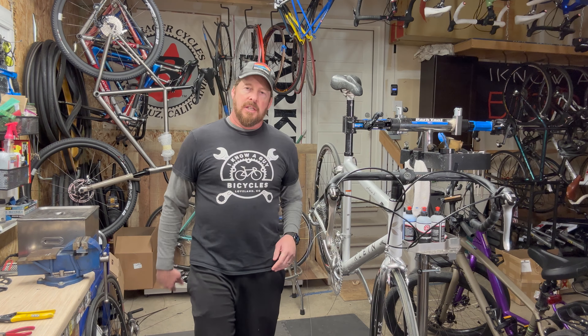On the rear derailleur it's usually about two to three inches. On the front derailleur I like to leave a nice extension, but then we'll be folding it back over onto itself and zip-tying it. Let's do a little close-up — on the rear I did about two to three inches, but here it's going to be more like five inches because I want to loop it over. I'll cut that and go with red cable ends.